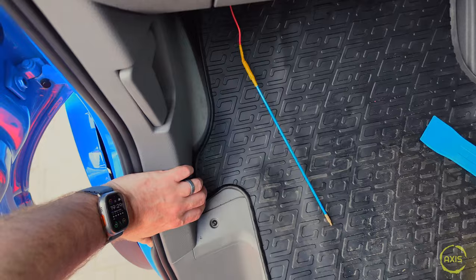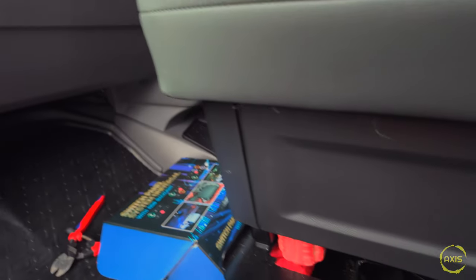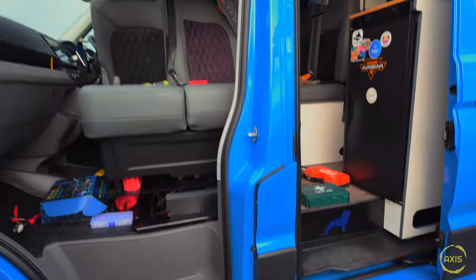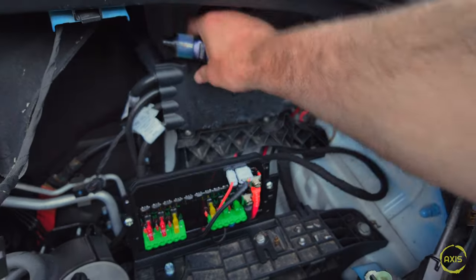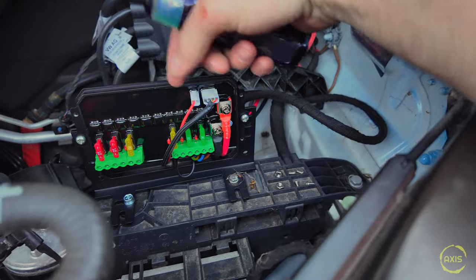I've also just thought I need a 12-volt ignition feed as well for the switch panel. That's a tight fit - switch panel will go up here. That switch panel loom will be mounted in there - it looks a bit tired but it's easy access for me flicking switches inside on the road. Next one I've got is the ignition live - I'll extend that. For fitting the switch live on the fuse box I had to pull the seats up to get to the top where the switch lives are, then run it through under the flooring all the way up, back up the A-pillar, back out to the bulkhead. All I've got left to do now is trim the big cable, stick the switch live on, stick the controller on, and then we'll see if we can light the street up.